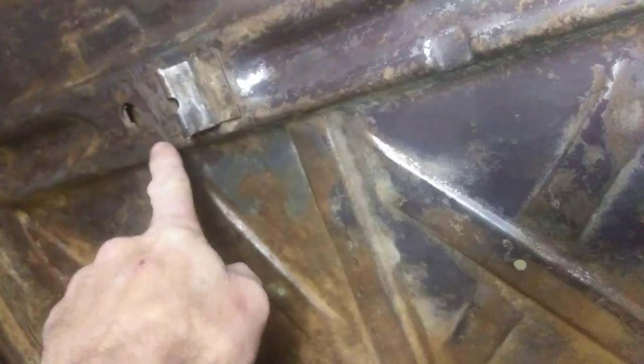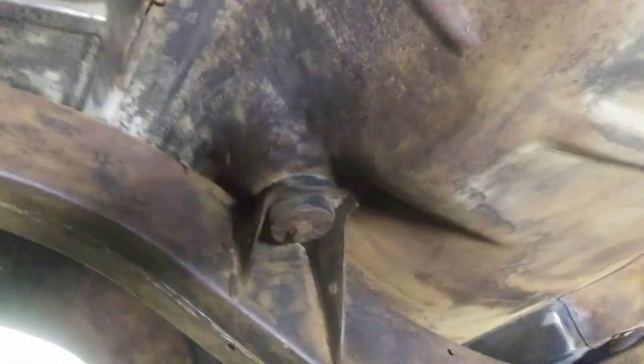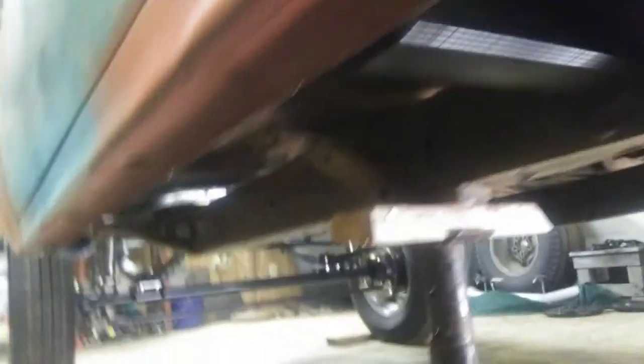I got a little crack here where the tank mounted - I'll show you guys on the inside of the trunk. The inside of the trunk is pretty nice, just a little bit of rust. We even got all these braces under here all cleaned up, ready for some rust converter. Might take me a while - you just put the rust converter on with a little cheap paintbrush, and it turns purple, then it'll turn black and then it's good for paint, good for priming.